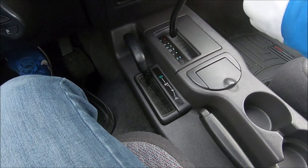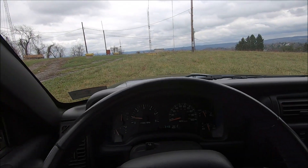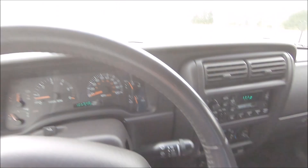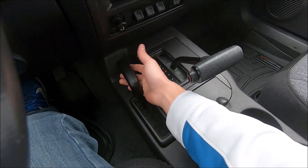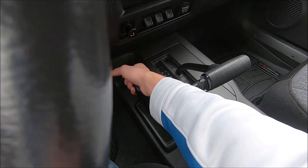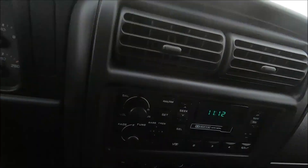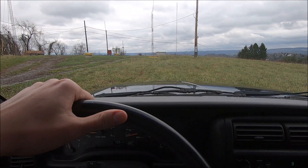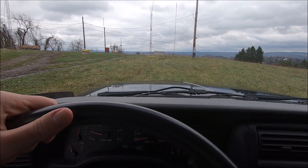As you can see right now, I'm in two-wheel drive high. We're going to start driving so you can see. You can shift into four high while driving as long as you're below 55 miles an hour, but I'm going to do it while at zero miles an hour. You just take this lever and pull it straight back with constant force while you're in drive. There we go — we are in four high. You can see the part-time light is up there on the dash, so that's how you know you're in four-wheel drive high part-time. This is only for loose and slippery surfaces. I'm on wet grass right now and driving in a straight line, so it won't be a problem.